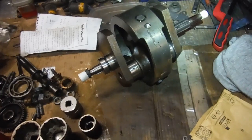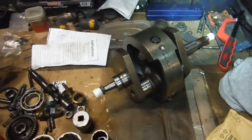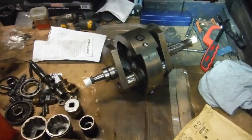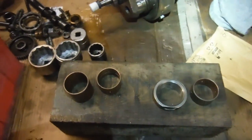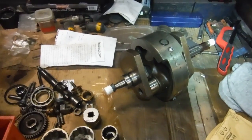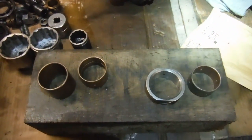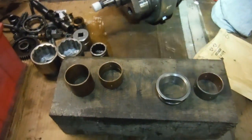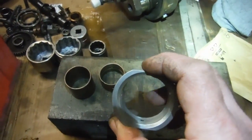The crank's already been up to Aeron to be assessed. It turns out the big end journals are okay, but the timing side journal — although it's on standard — is about half a thou below the minimum allowable size and also about half a thou out of round. So we've got to true it up, but we're pretty confident a new standard timing side bush will cope with the very slight amount of material that has to be removed, because a new standard-size bush would probably need honing out by a small amount anyway.